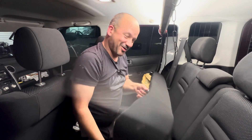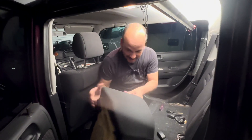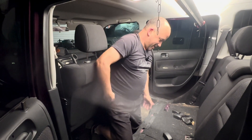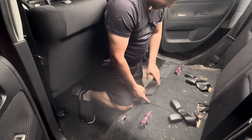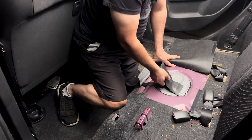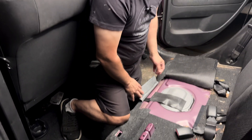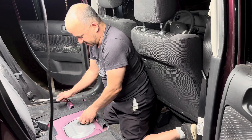I'm going to push it out this way so I don't knock this light out. Oh look at this — a light bulb, that's a keeper. Now I'm going to clean this up. Look at this here — this is where the fuel pump is. The access hole: you just move this carpeted flat back and there it is. You just pry this up — this is just a little protector cover for the wire, just adhesive — and then we should be able to get to where the pump is.